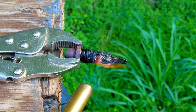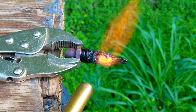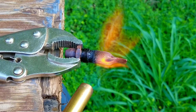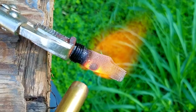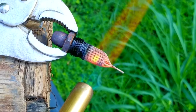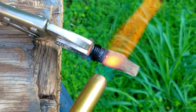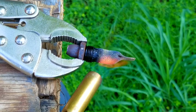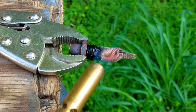Now, I can already hear someone in the crowd saying, just throw away the spark arrestor screen and this won't ever happen again. And I hate to say it, but first off, the trimmer is going to sound like a small chainsaw, which is quite loud for residential use. Also, it's for the owner to decide what they want to do, so I'll leave that up to my dad. And besides that, the screen is there to keep sparks from leaving the engine and starting a grass fire, so I wouldn't want that sort of liability on my hands. If you choose to throw yours away, that's your choice.